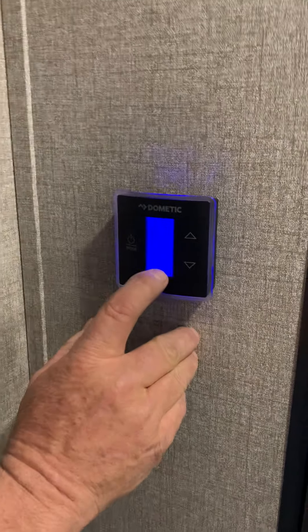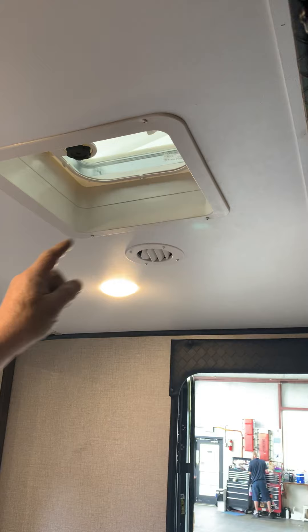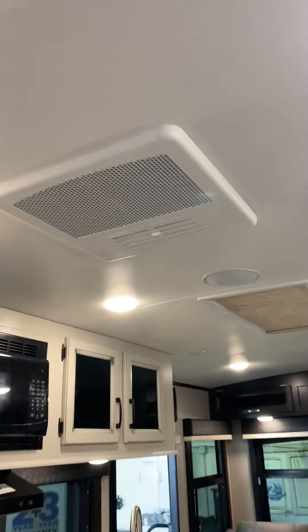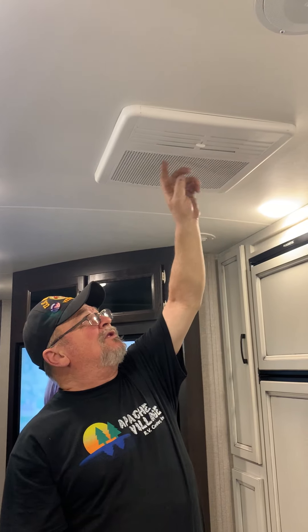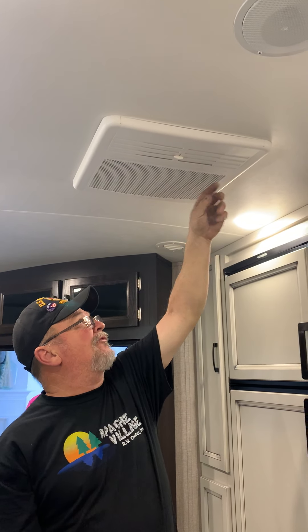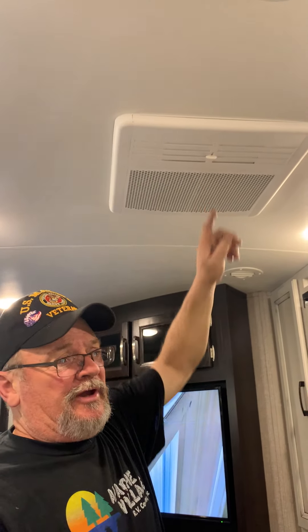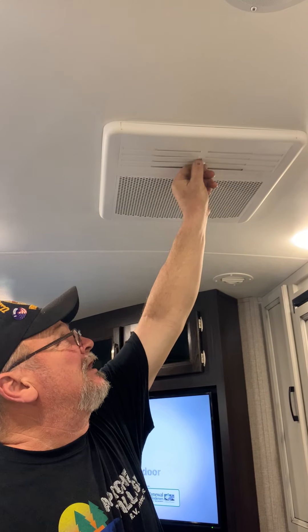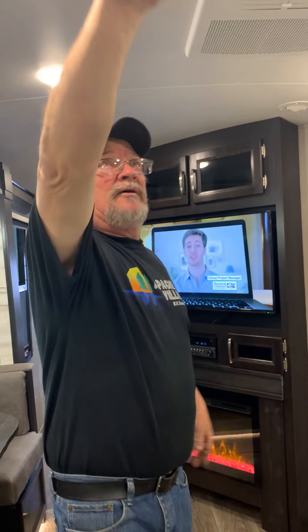The next setting goes to cool with a little snowflake symbol. Run your thermostat up and down. You have AC vents in your ceiling. Your AC is right here and there's an AC filter inside — when it gets dirty and turns brown, put a screwdriver in the slots, pull it forward, wash the filter out, put it back in. There's also a quick cool feature: push that little lever and it directs all the air supply down here like a tornado to cool the space fast. Push it up and it directs air out to all your AC vents.